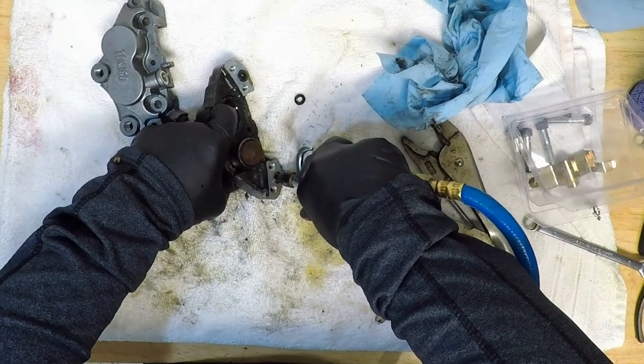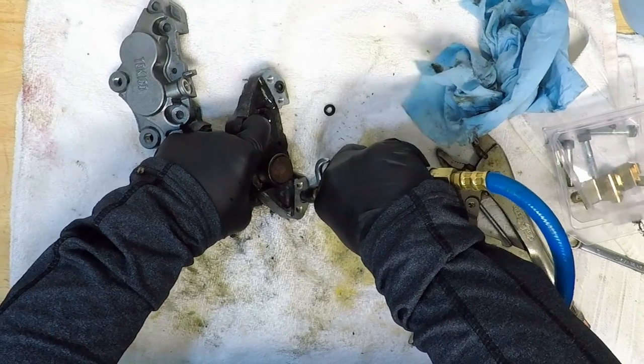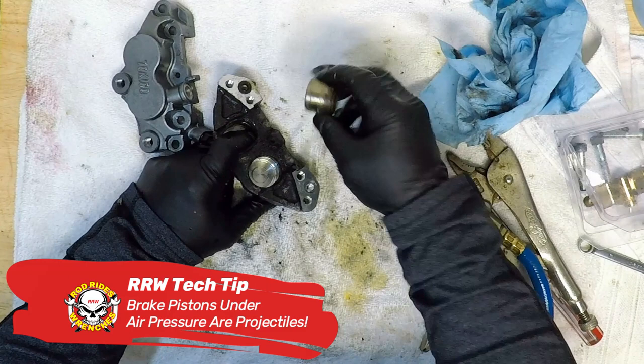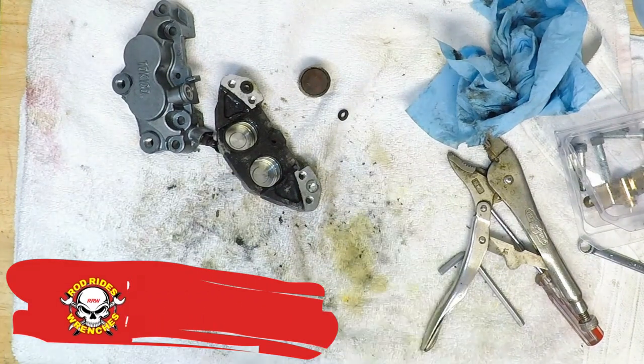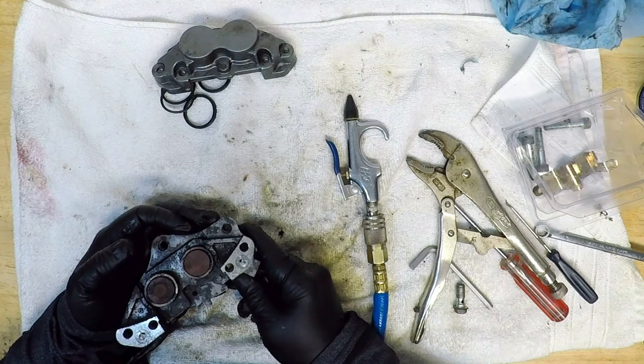When using compressed air, be sure to start the airflow at the nozzle and then push the tip into the caliper port. Removing pistons this way can be dangerous, so if you're going to try this yourself, make sure the pistons are pointed away from you when applying air pressure. These calipers are being a real pain in the...